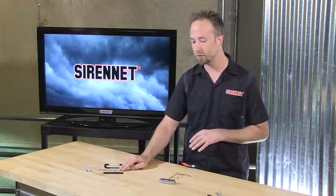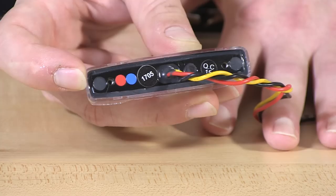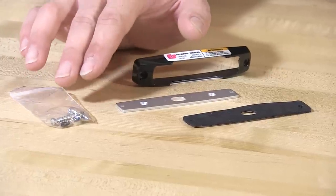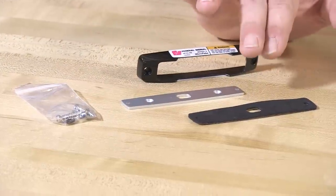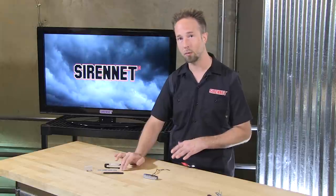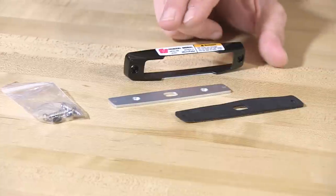With the surface mount bezel, additional hardware is going to be affixed onto the back of the MicroPulse C-Series. Federal Signal has done a wonderful job doing some insets with very small threading for adding on the hardware. Hardware is included — this is going to take care of the self-tapping screws for surface mount, and the other small hardware for fastening on the back thin aluminum plate and the gasket to protect everything. This seals the back of the MicroPulse C and keeps grit and grime from getting into the back and the board, and keeps it from being metal-on-metal during installation.